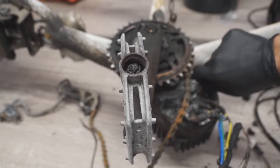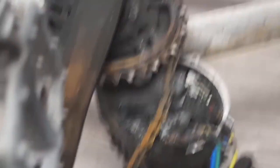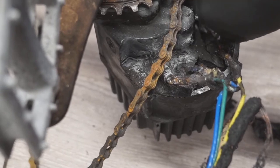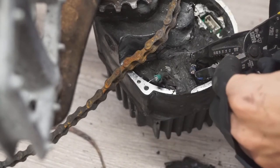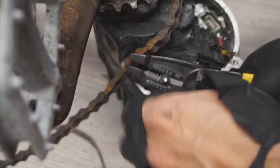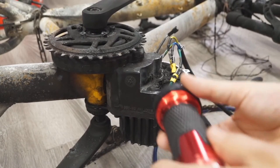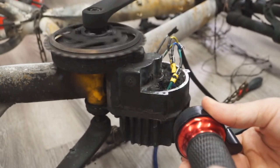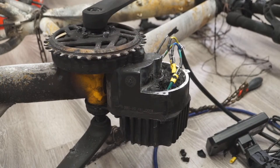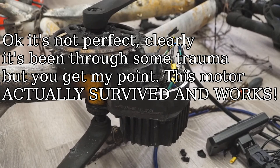We're starting to see the green of the motor PCB, the hall sensor board. I'm clear over there for plugging in the hall sensor connector. That's a wire — a very shitty wire, but it is a wire. And as you can see, when I spin the throttle over here with my phase runner controller... do you see that? That is spinning. That is beautiful. So the motor itself is actually working and just fine, which is pretty cool.